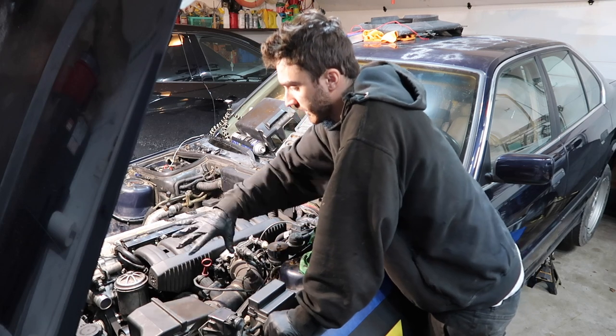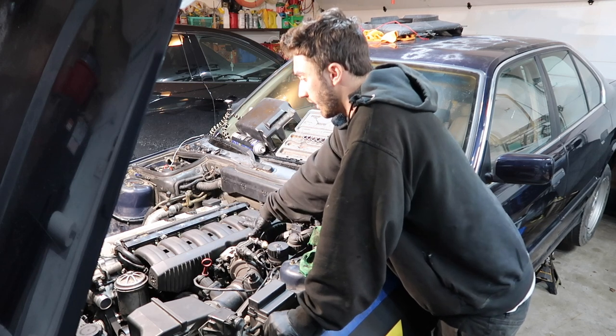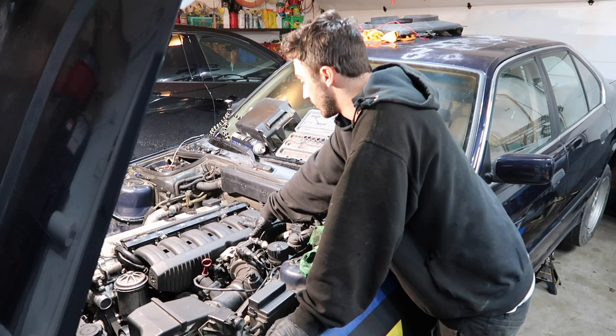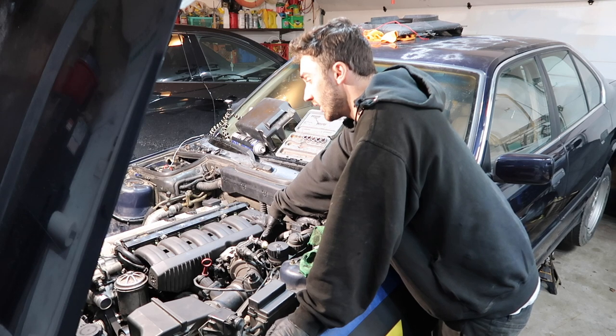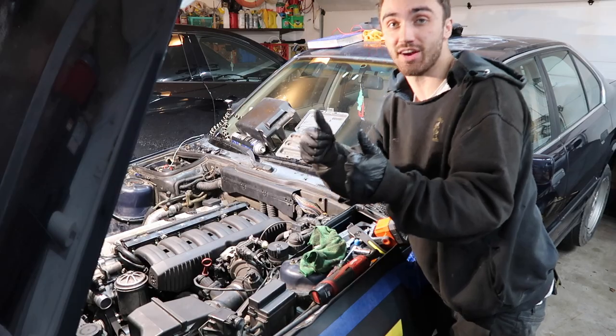Weird noise. I say let's get the coolant system hooked up, drain the oil, put fresh oil in it, and then bleed it, make sure it gets to temp, and we should hear the valve train quiet down. And yeah. Hey, successful first start, that's sick.